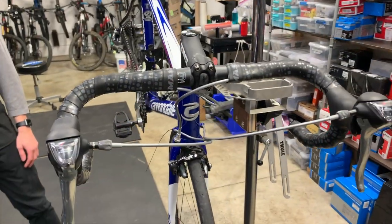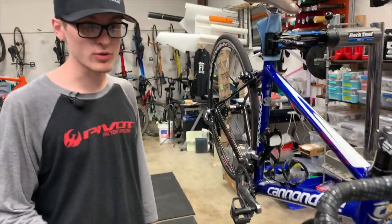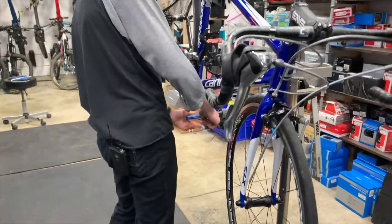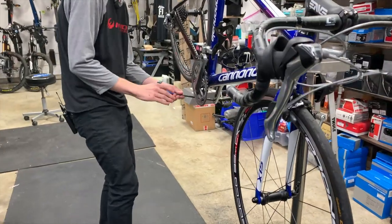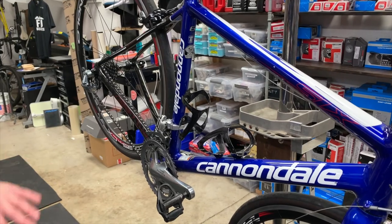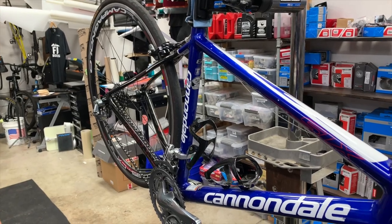So how are we going to tackle this? Where are we going to start? Everyone's process is a little different. I usually start from the front of the bike and work my way back. I'll probably start with stripping the bar tape, marking the shifters and everything and taking those off, removing the cables, getting some new cables and housing, new cables onto the bike, and then moving my way back starting with the crankset, bottom bracket, chain, derailleur, cassette, and then adjustments.